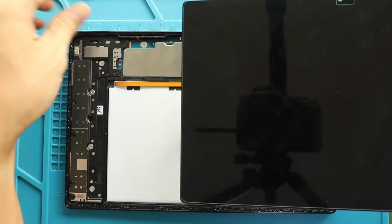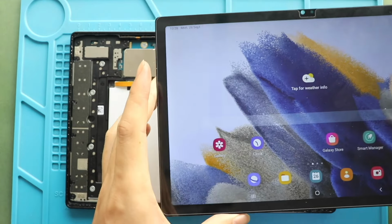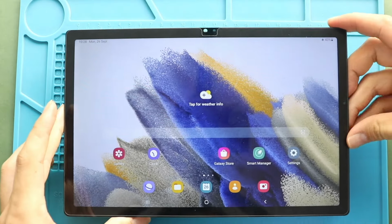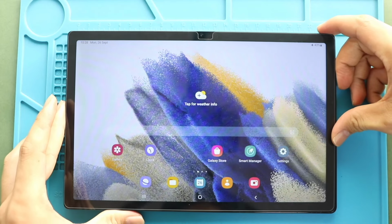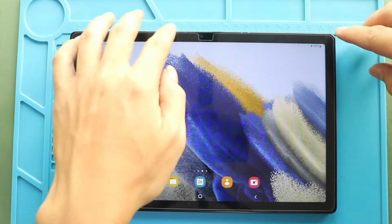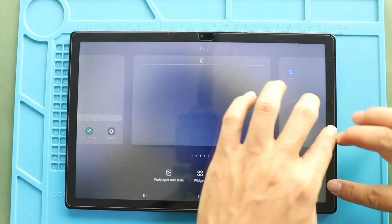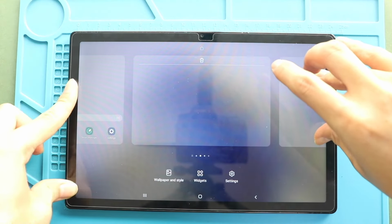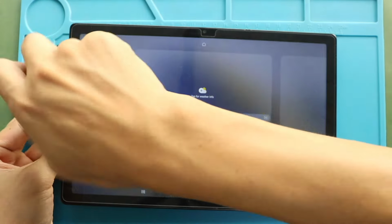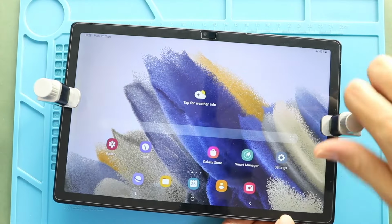Next, gently slide in the screen from the bottom to the top. Slightly apply pressure on screen edges. Finally, we are adding binding clips to fasten the LCD screen. Leave it for some time and remove it. If not, use some rubber band to tighten the screen to the body.